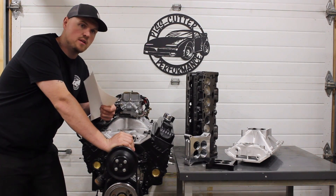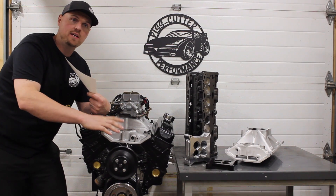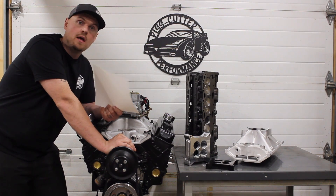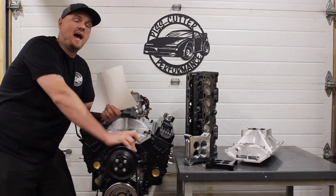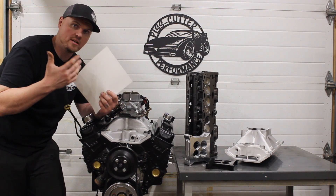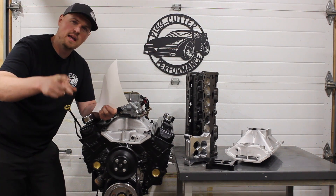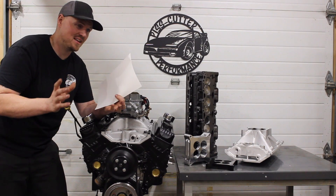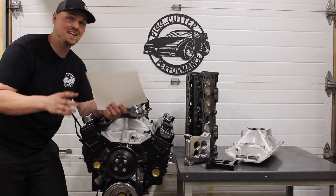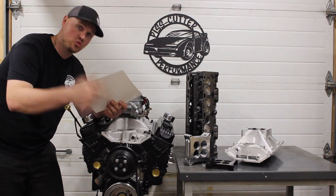You could reuse the stock lifters on this thing, but I had a set of low-mileage LS lifters. LS lifters — pre-AFM, like the early LS engines — or LS7 lifters will fit in these engines, they're exactly the same. I had pretty low mileage on a set of LS lifters that were cleaner, so I used those. Could get away with the factory lifters as long as you keep them clean and they're still in good shape. Be careful putting lifters through a parts washer unless your degreaser is very clean — I prefer to hand-clean them individually. Just make sure you don't introduce debris or dirt into your lifters.